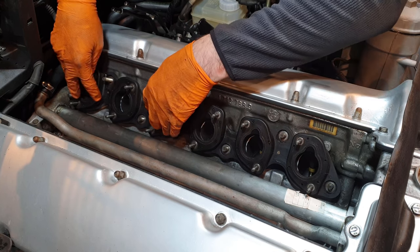These are both original fuel rails with 12 original fuel injectors installed — they've never been replaced and I've tested every single one; the resistance is fine. But I've come this far, and especially with the fuel delivery system, I want all new components. So I've splashed out on a full new set of original OEM Bosch injectors from Bavarian Work on eBay — I highly recommend them, incredibly knowledgeable and they specialise in injectors. The full set was around 470–480 euro, which for 12 injectors is incredibly cheap.